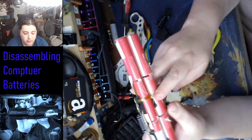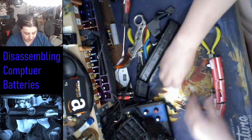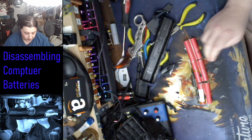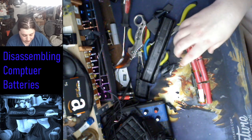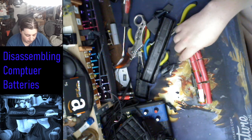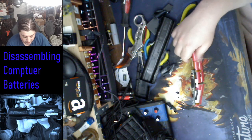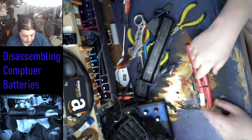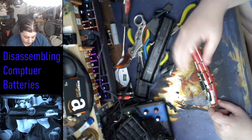So in lithium ion, you're not supposed to really heat these up too much. Oh crud. Well, that's going down. There's no way I'm bringing that back up. But unlike lithium ion, nickel based doesn't matter if it gets really hot, but during the charge of lithium ion batteries, you got to make sure not to overheat them or it'll damage their life capacity. Heating them up in general is kind of bad for lithium batteries. So they got 2 temperature sensors on this battery, to make sure that they don't overheat when they're charging or discharging, for that matter.